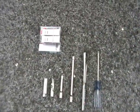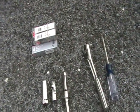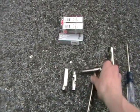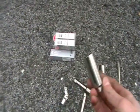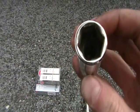Today I'm going to show you how to change spark plugs in a six cylinder Honda Passport. What you're going to need is a standard 3/8 ratchet, extension — in this case we need two extensions because of how deep it is through the valve cover. A swivel for the hard to get ones in the back, and this is a spark plug socket, in this case it's the 5/8 one.